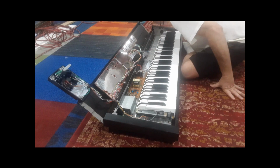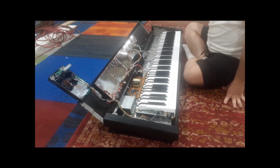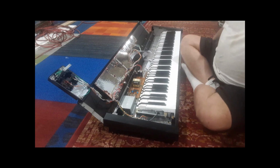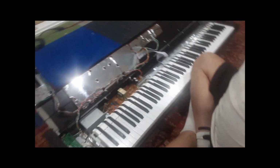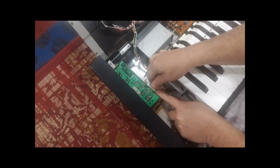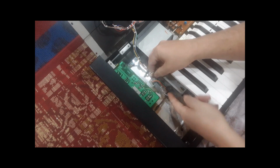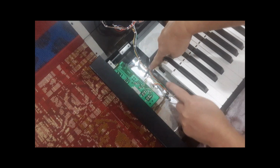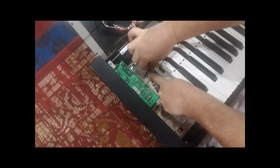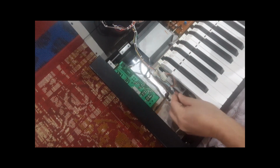All right, so now that all 9 screws are out and the 5 underneath, we can go to the next step, and that is lifting this up. But before we do that, we need to remove, and I'm going to temporarily move this over to here so you can see what I'm removing. It's hard when you don't have a cameraman. So first, on these connectors, we're just going to hold the board underneath gently and then wiggle these off. And then on this little black hook down here, you need to take the harness. You might have to flex it up a little bit. And make sure you get the harness above the hook, completely above all the wires, above the hook. And that's going to give us the slack we need.